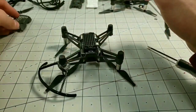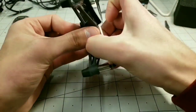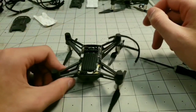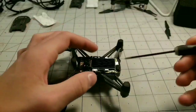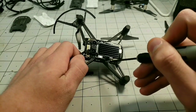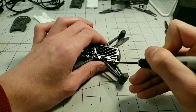You can just pop that off and put that to the side — don't lose that either. With your finger, hold this in place, flip this over, and we're just going to pop this off too, just so you can get a clear view of the wires down in there. Once you get all that done, flip it back over, and this is where we're going to see which motor we need to replace. These motor wires run along this arm right here and they're held in with a little bit of glue. With your screwdriver, just kind of pick that off — you're not going to get it all off, but just do it enough so you can free the motors.